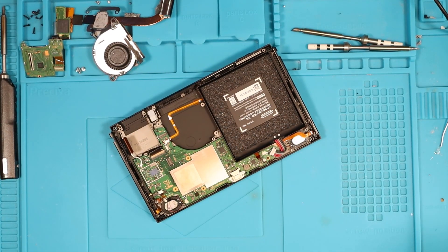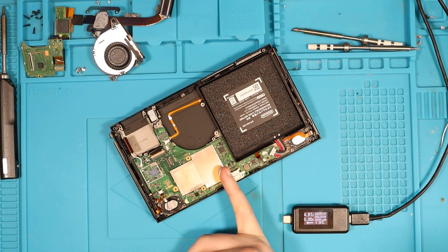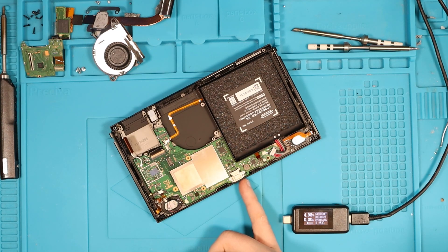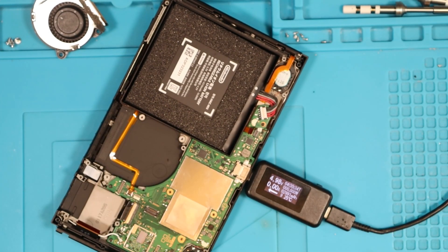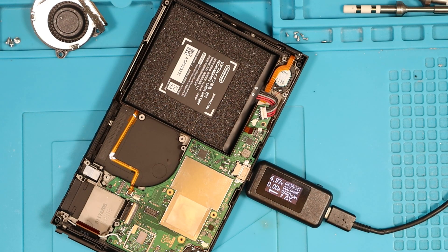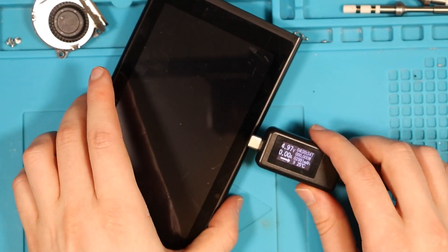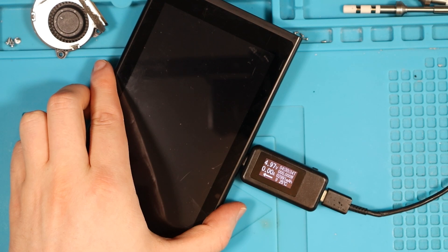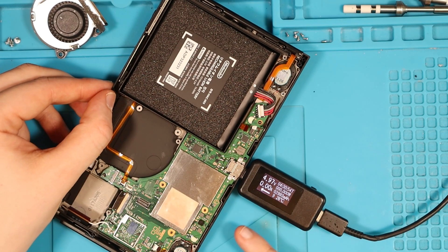I've put it back together enough to test. Taking the USB amp meter and plugging it in — very nervous. If this doesn't work, I'll test other things because I realize I didn't actually test M92 or check for shorts elsewhere. That old faulty charging port could have caused a short somewhere around the board. Testing now: we get a 0.4 amp draw on one side, but 0.00 on the other side. So it works one way but not the other — the port job hasn't fully worked.